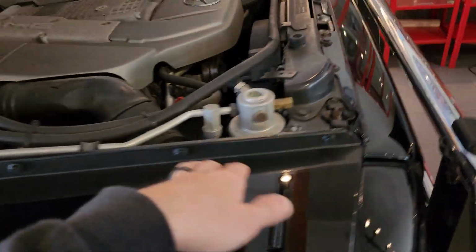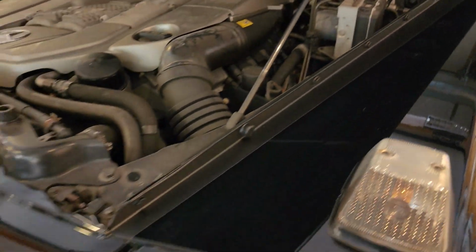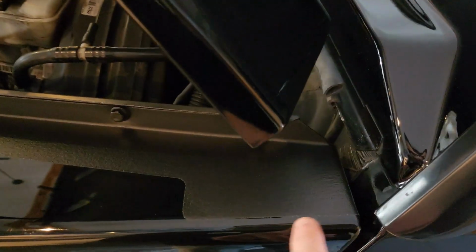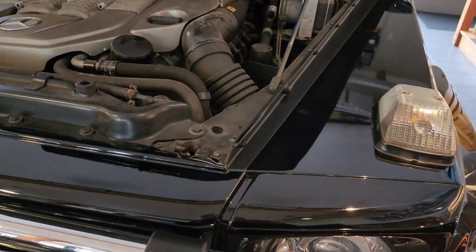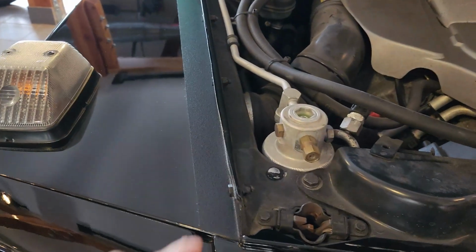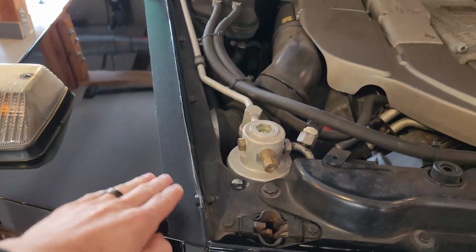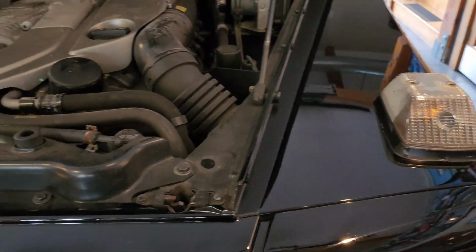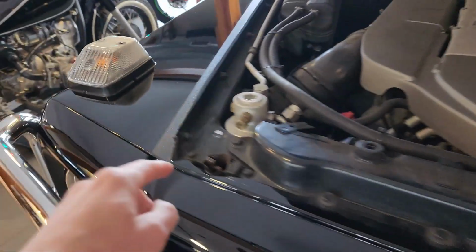So now that has some more protection, especially against things settling in there and causing corrosion. And then of course, to match, this fender was fine, but we applied it on this side as well. So same exact shape and measurements. And you may be wondering now why this side, if we look, is thinner than this side. We can see it's considerably more width with the chip guard on the left side. Well, that's actually because the hood overhangs more on this passenger side.